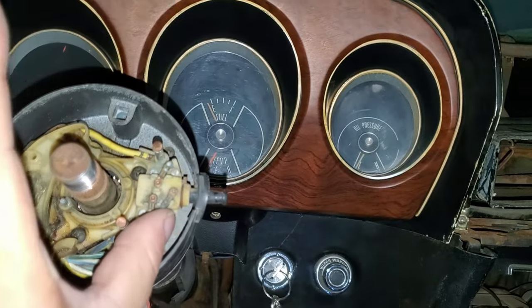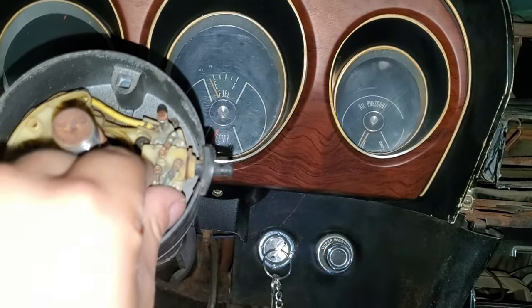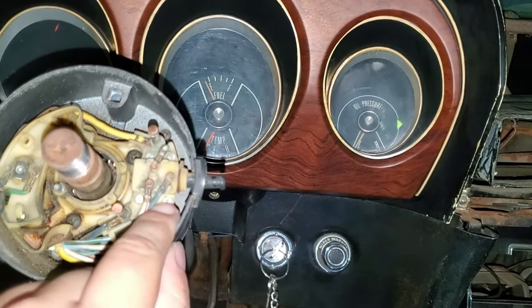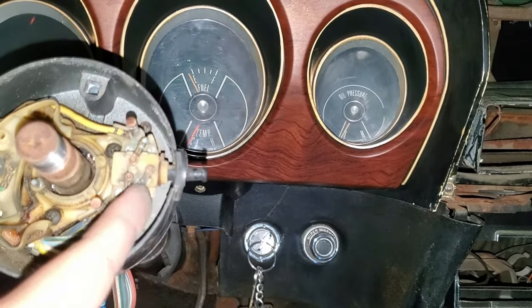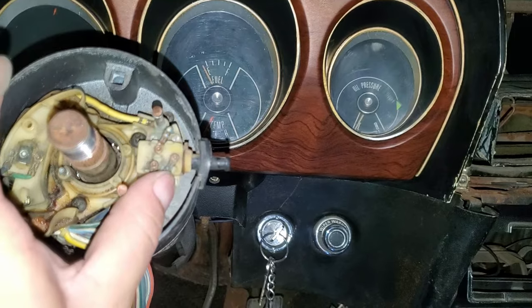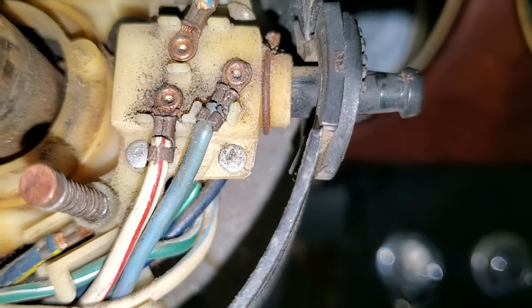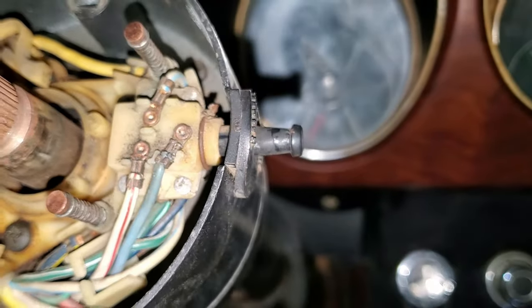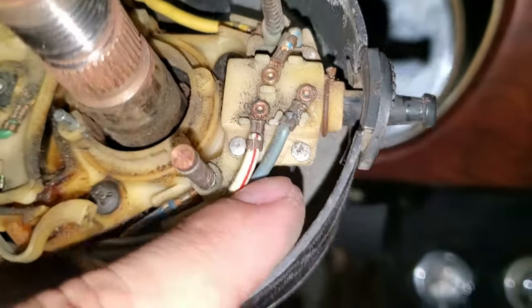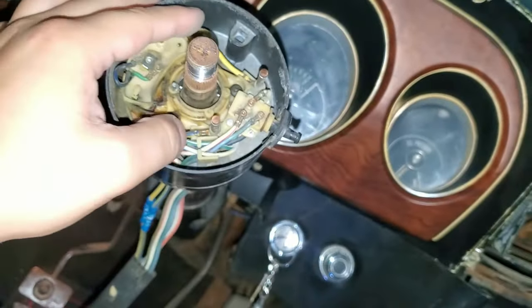It wants to come back, let me help it out here. See that? And then I stop helping it — see. All right, let's help it out again. So my problem is a hairline crack. I'm going to turn the key off now. There's a crack right there — I don't know if you can see it on camera or appreciate it — but there's a very small little crack right there on the body of the hazard portion of this turn signal switch, this multi-function switch.